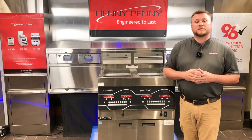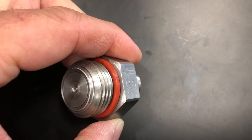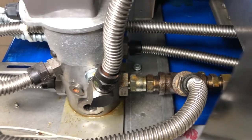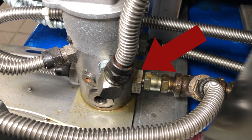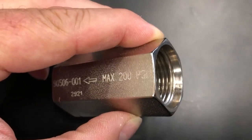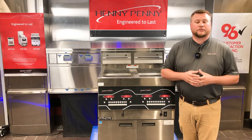Keep in mind you may see two different kinds of check valves depending on which model you're working on. There is the SAE style check valve, which is shorter and smaller, resembling a fitting — it can be overlooked and mistaken for a regular fitting when looking at the selector valve. The other is a much longer standard check valve that will be very obvious when looking at it on the fryer. You could encounter either style on the gas fryers you're working on.